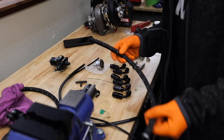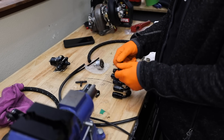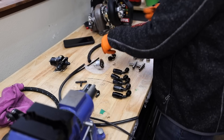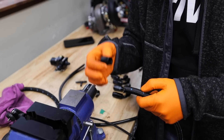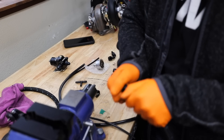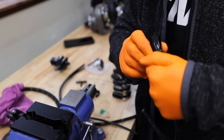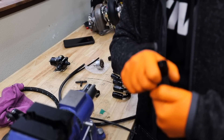First thing you obviously have to do is cut your line to length. I went up in the engine bay and took measurements to make sure we were all good. Next we have to assemble the line. These AN fittings come apart in two pieces — you've got a nipple-looking piece on one end and a threaded insert on the other. Now these little nuts are reverse threaded, so instead of lefty-loosey righty-tighty, it's righty-loosey lefty-tighty. You push and reverse thread them on and they just go right on. You're going to get the AN fitting pretty snug in there — there's a small retaining wall inside the line that you want to get close to.